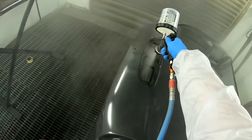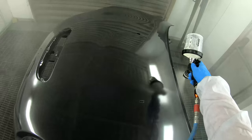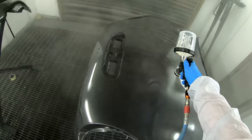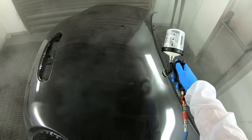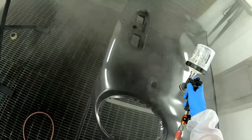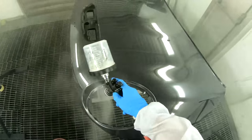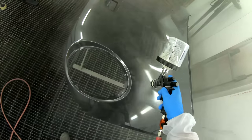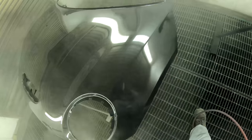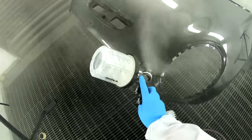If you really don't want to jump from fast or extra-fast down to slow, knock it down one — go from fast to medium and just see what kind of finish you can get. If you're in an environment where you don't need to go as fast, just slow it down — you might get a better finish and not have so much polishing to do. I remember working in a place where there wasn't a huge rush getting the cars out, you just wanted them right. So hit the normal hardener, give it a longer flash off, and you're laughing — you've got a lovely job.